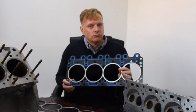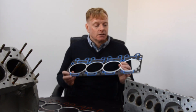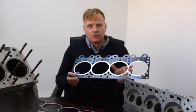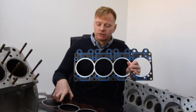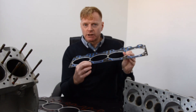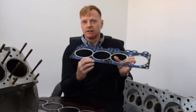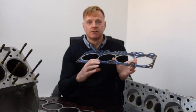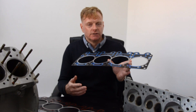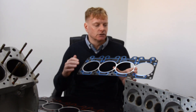This new gasket is designed really for engines that have seen service, which is of course all of them. The key difference is that this gasket is more forgiving — the original doesn't have the same forgiveness. What we're talking about is compression on the body of the gasket, but also, even more important, rebound — meaning the gasket actually snaps back to its original size when the engine cools down. I'm going to tell you more about that in the next video where we really go into the construction of the gasket.